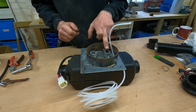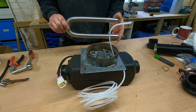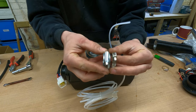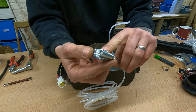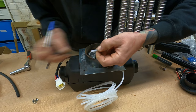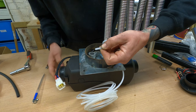This is the standard exhaust that comes with the heater, but it isn't long enough to safely reach a location on the van, so we're going to be extending it and installing a larger exhaust. Depending where you install your heater, this exhaust may or may not be perfectly adequate. To do this, we're going to be using official Jubilee clips, and you can see why — there is a huge difference between the cheap clips sent in the packaging and a proper official Jubilee clip. These will last much longer because they're going to be living underneath your van getting covered in dirt when you're driving. A little tip when fitting the exhaust: work out exactly how far in you want it to go, put a pen mark on there, and then when you push it in you know exactly how far in it's gone.